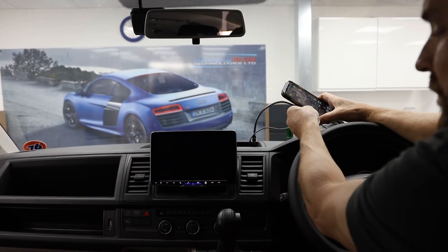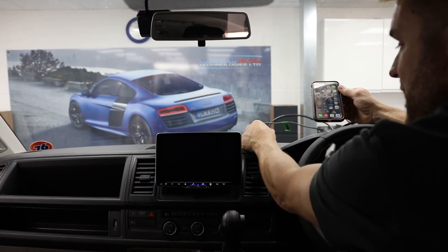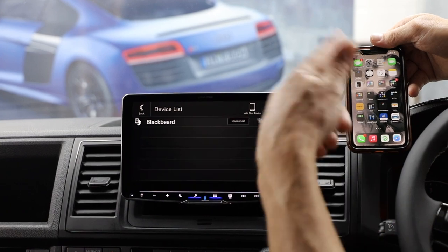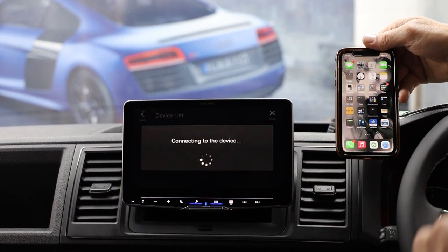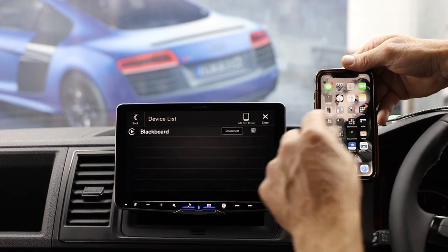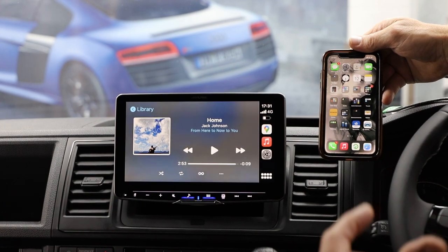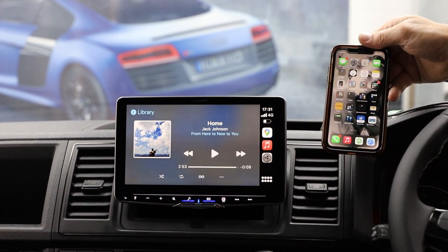Once you've done with your YouTube video, to get back into CarPlay you need to disconnect from your phone and remove the leads. Then go back into setup, go into device list — it says it's connected but you hit disconnect, then hit connect again, Apple CarPlay is ticked, press OK, and that will wirelessly reconnect to Apple CarPlay. We are so pleased that this device has so many features and functions. We're going to do another video soon just about the 720p panel and the HDMI out so you can see the workings and decide if you want this fitted in your vehicle.